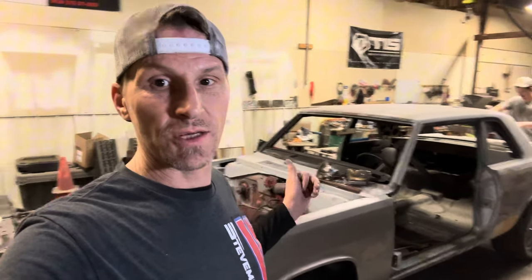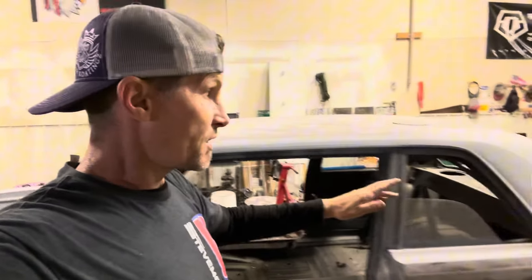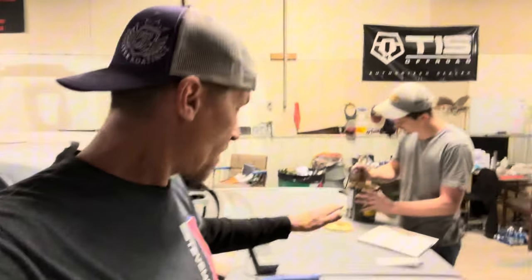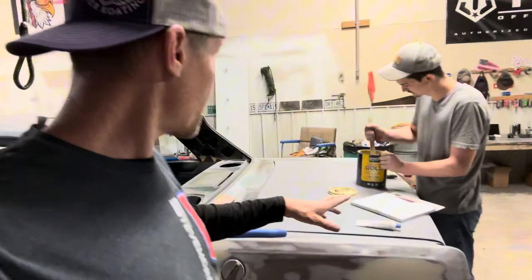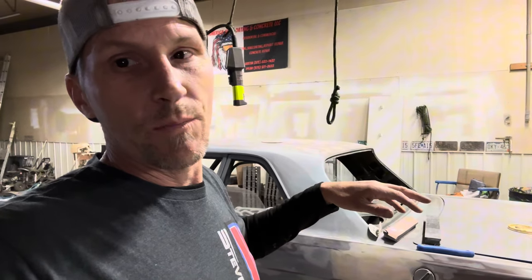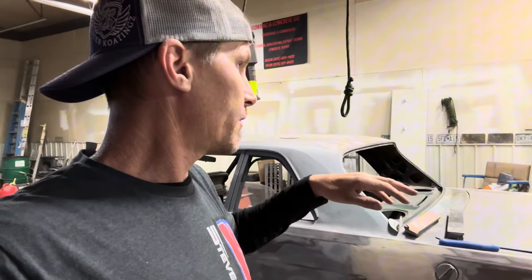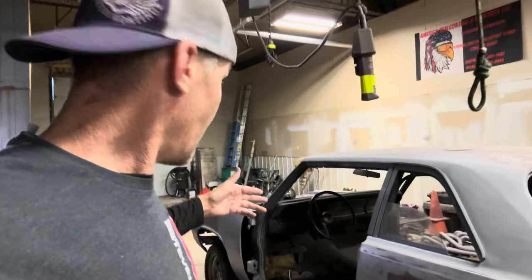Right now he's finding those low spots and he's going to mix up a little bit of filler to see how it works. This is U-Pol — it's not sponsored, it's a good price, and it's supposed to have low contaminants. We've got more on the way. Alan's going to mix some up. There's a proper way to mix it and a non-proper way — you don't want to put it in a mixer, although that might work. Maybe we should try that sometime. Let us know in the comments below. This fender is about ready to look like a proper fender.